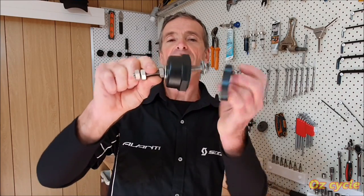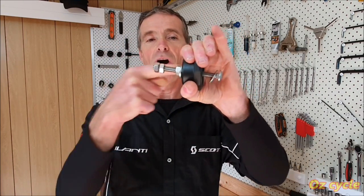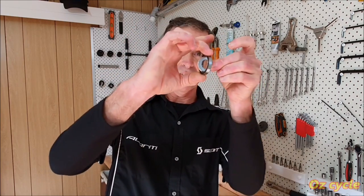Now these poly parts, if you find them difficult to get, keep hunting around. I'm sure you'll find something. Hardware stores, irrigation shops and the like. So the principle's there. All it is, is a heavy duty cup shape with a hole drilled in it, so you can put your bolt through with a few nuts. So out for your washer. Don't forget, file both sides. If you make a mistake, hey, 20-cent washer, get another one and keep going, and you get it so that it fits through the bearing nicely.